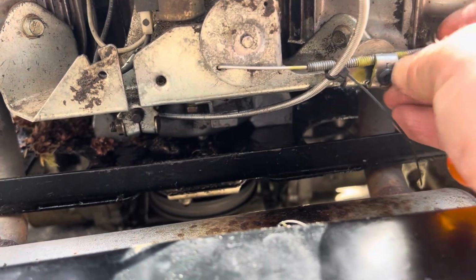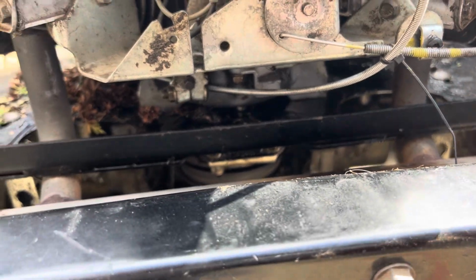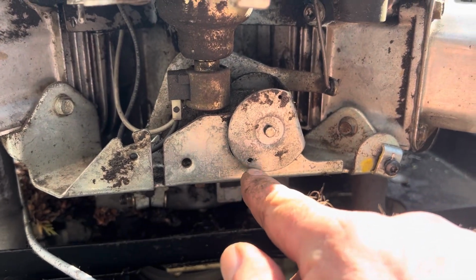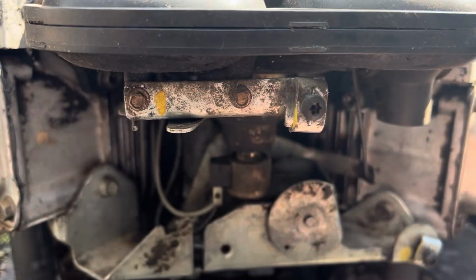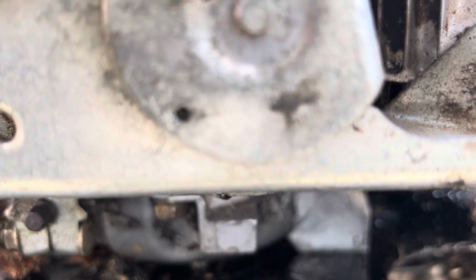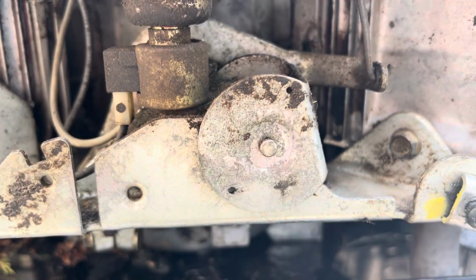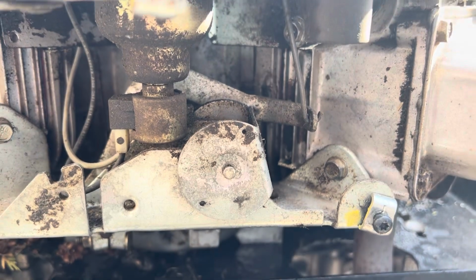Maybe to there, and then you can slide it out from underneath like that, and then we'll unhook it off there. Okay. If you find you have multiple holes where your cable goes, either one of them, just put a little paint pen mark there too, and you can actually tell because it's got a little bit of wear. But anyway, I've only got the one hole there. Some of them have multiple holes, so just to stop yourself from guessing, give it a quick mark.